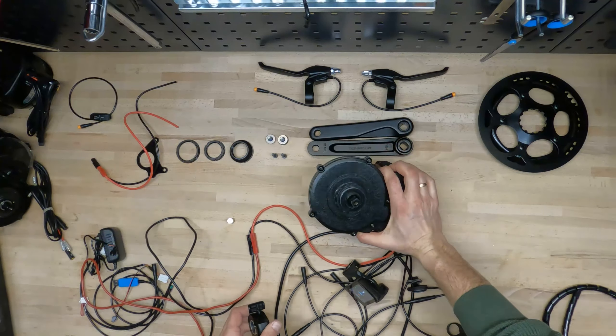From the inside, this plastic cover looks normal — looks good, it has a seal. It looks like some motorcycle motor here. Here I see white grease for nylon gears from the hub motors — different from what Bafang company uses in mid-drive motors. We can see a special output gear here.